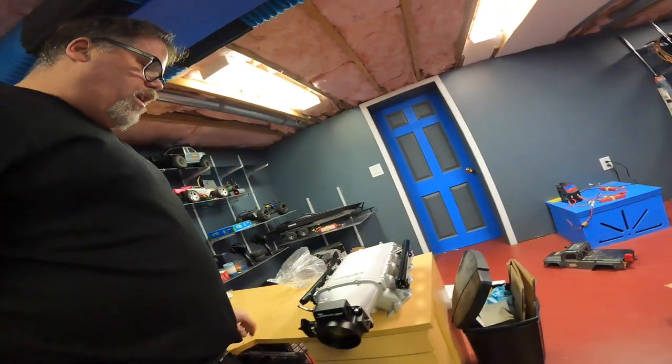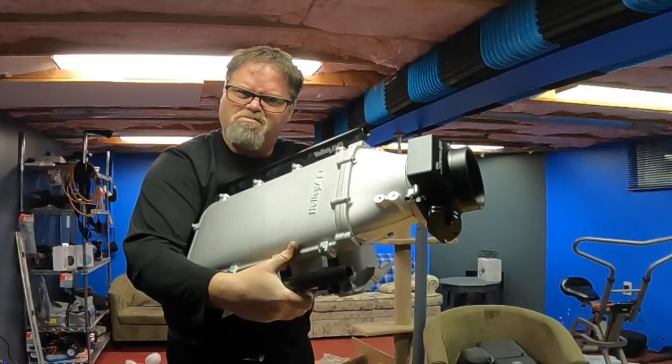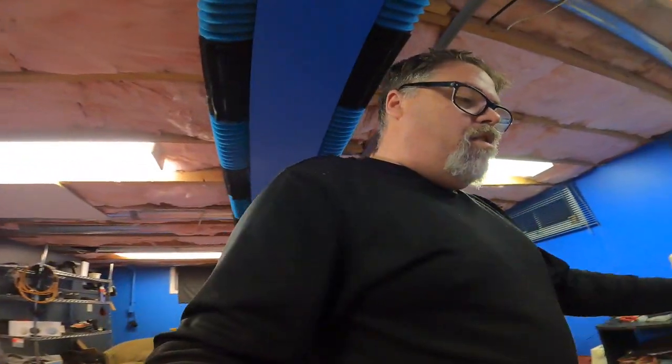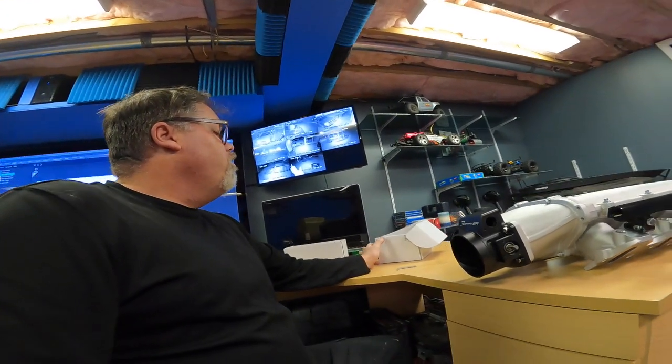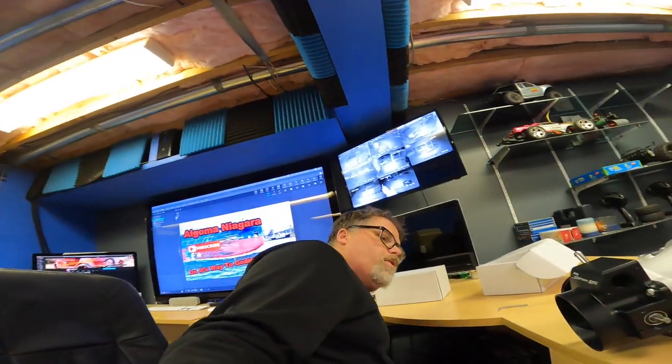That's going to be on a 1993 GMC Safari van. We're going to put a six liter in my 1993 Safari in the spring, and this is the intake we're going to go with because she's going to have turbos and everything else one day - baby steps. The throttle body part number is 86005-1, and the intake is 300-621, the Low Ram Holley intake. I went with a low ram because I don't have much room in the engine compartment since it's got to go into the doghouse.